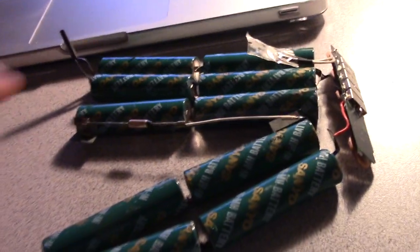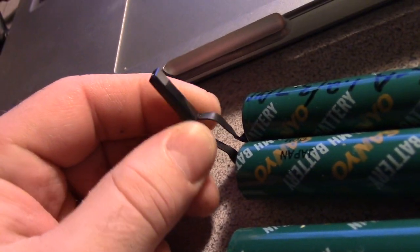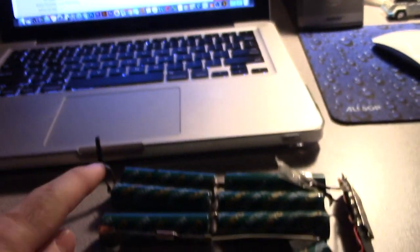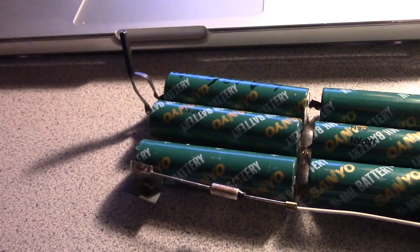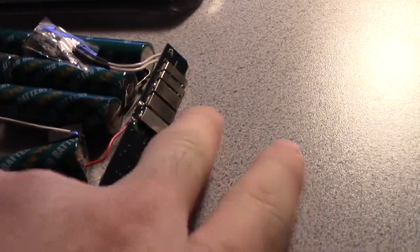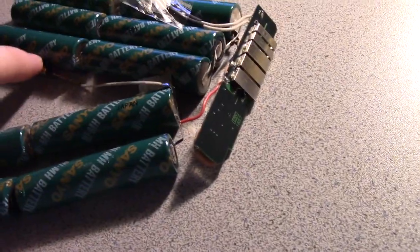And that's there in case something happens. If the pack shorts out, bam. Now, this one over here is a thermal cutoff switch. If the battery pack overheats but doesn't short out, this will cut off the continuity. So, if anything happens over here, you're protected both with a fuse and a thermal cutoff. Now, what's all this? What's in here?